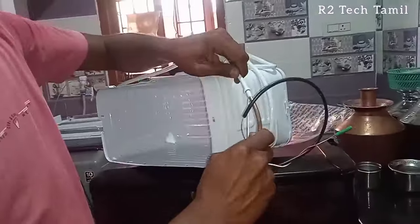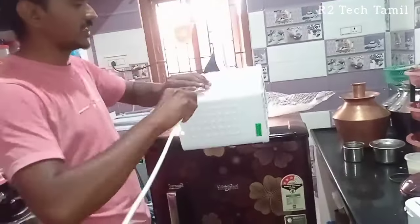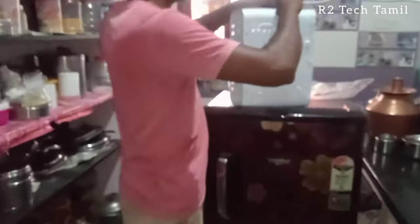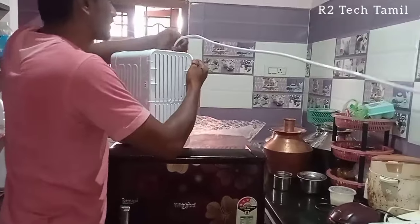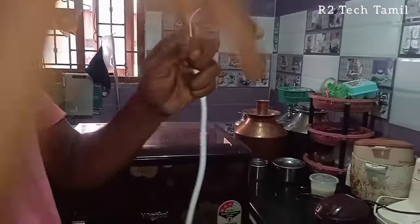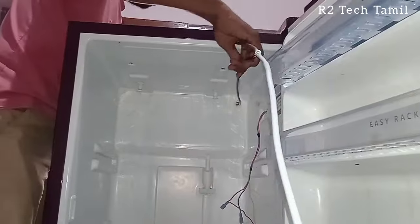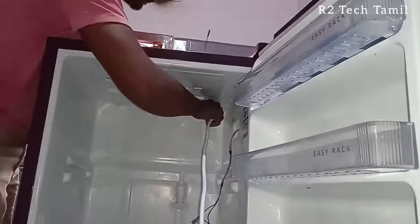We need to get the freezer box and the white paint and the aluminum pipe. We need to route the capillary in the same way — capillary plus suction line, and the pipe will be the same. We will fix the freezer box. The capillary will be copper, the suction pipe will be aluminum, and the other part will be copper. We will remove the pipe from the hole and straighten and cut it.